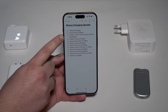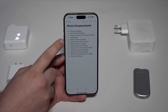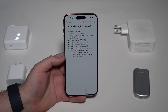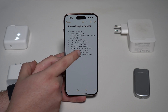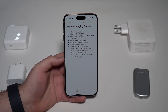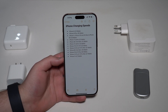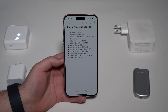As you can see, it varies — 12 watts for the iPhone 8, going up to 18 watts on the Plus, then the iPhone 11 series at 22 watts, the 12 series at 22 watts, and so on. The latest iPhone models top out at 27 watts. The iPhone SE is always slower and less capable — even the SE 3 is only 18 watts, and the SE 2 is 12 watts — because those are cheaper iPhones. But no matter how powerful your charger is, it'll never charge past 27 watts even on the latest iPhones.